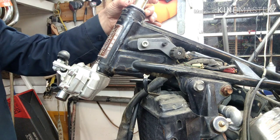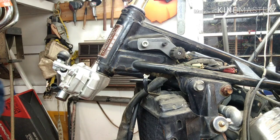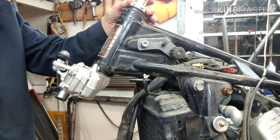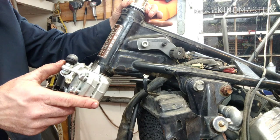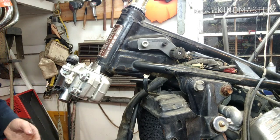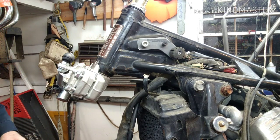This is where an aftermarket stem will do you right, because you knock it in there, it gives you extra length right here. So the bearing is in a good place. There's just not enough thread coming through in order to get that lock nut on there. If we run no washer, it can lock on like that with no washer, but you're only biting by like 2 threads there. Not too comfortable with that.